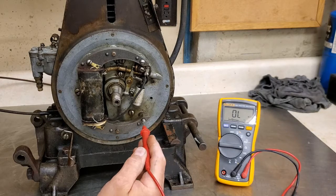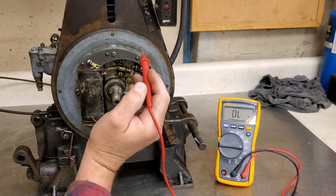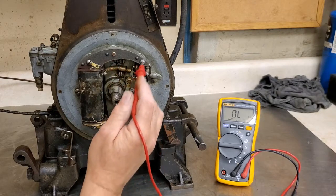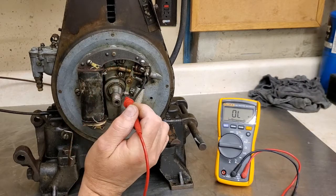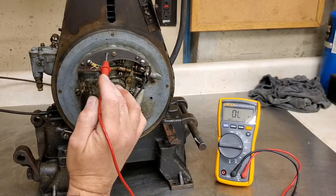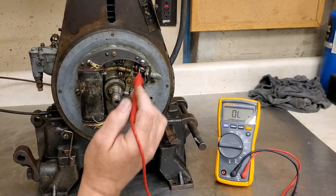And on this one, you can see here too, it uses the 4 corner screws like early Briggs motors. The Model Y, I do have another coil, it uses just 2 screws here and locating pins. And you can see the rivets. Now I talked about this in my earlier video on the Briggs PB. They have the rivets here, and they use these 4 screws. And that's what I did.